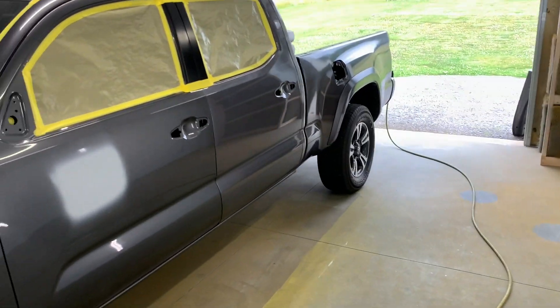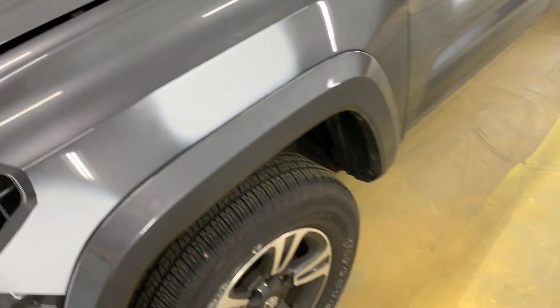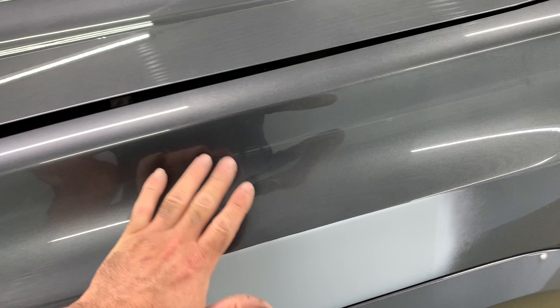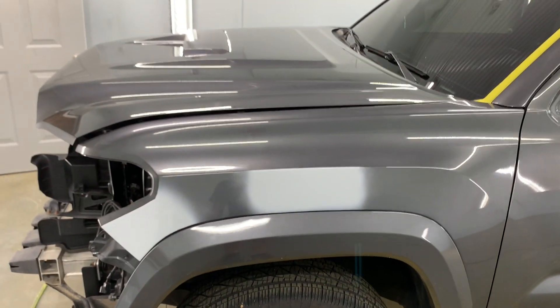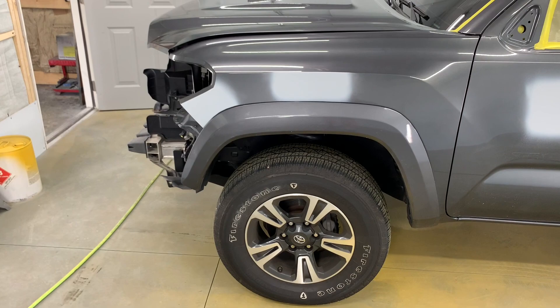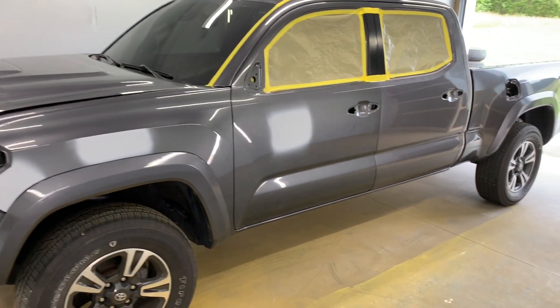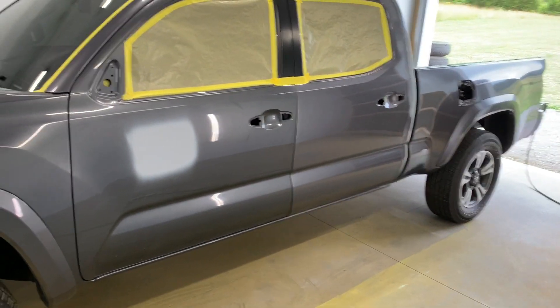You have to watch out for that because even in a makeshift paint booth, overspray lingering will sit on top of this fender and change the color to the hood if that's where you want your blend. I'm going to try and keep my color right in this area so there's a transition where you can't tell if there's any slight color difference. Once I get this all sanded I want to take the bumper and grill the rest of the way apart and prep them to sand. They're supposed to bring me two spray-out colors I picked to see which one's closer.